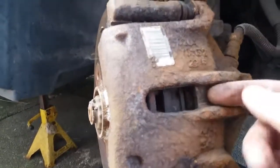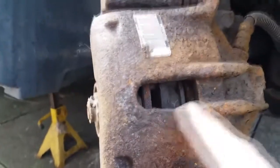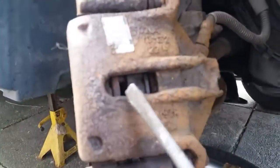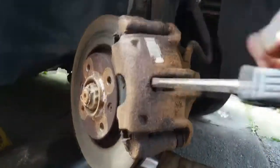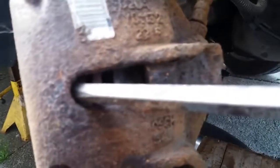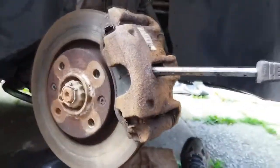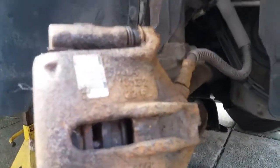The first thing we're going to do before we touch anything is push the piston back. Because we're putting new brake pads in, the old ones have been pushed by the piston and they've worn down, but the piston stays out. So if we try to put new brake pads in now they won't fit because the piston's still pushed out. We're going to push the piston back before we do anything - that's why we needed the screwdriver. Find a suitable space, fit it in there, and pull like that. Keep pulling and that's pulling the caliper out but also pushing the piston back in. You can feel it's loose now - see that sliding? That's sliding because it's loose.